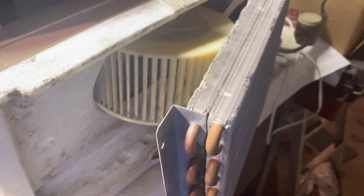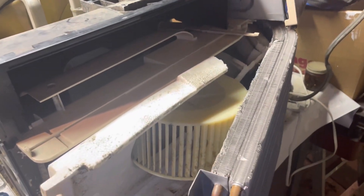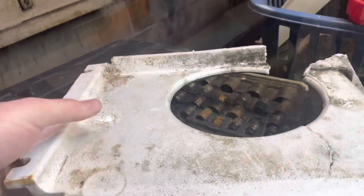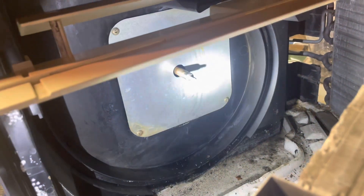And even though I got all the screws out, it's still been a pain in the ass to get out. I love these air conditioners, but they are such a pain in the ass to work on. I finally got the nasty thing out. As you can see, it still needs to be cleaned a lot. I'm really glad that happened. Got the blower wheel out — now I can at least put some oil in there and get that motor quieted down a little bit.